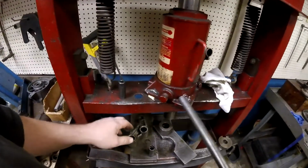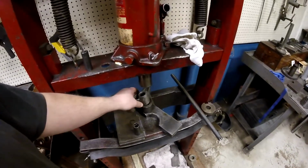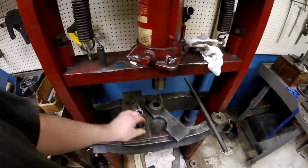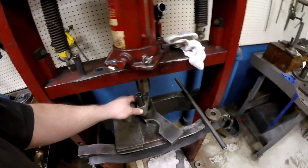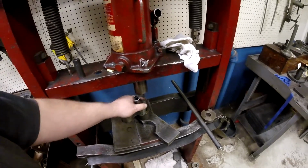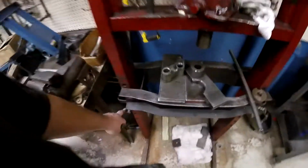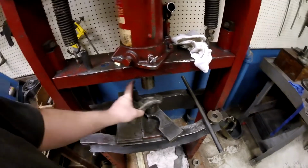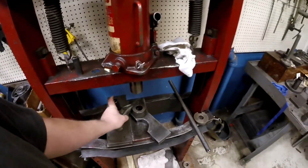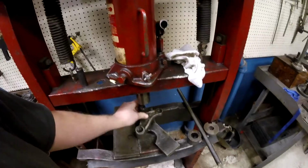Yeah, what we're gonna do is find a nice surface to put that on, just like that. I'm just using this bearing to go in there as a press. You can use wrist pins or whatever other stuff you have laying around. It's no big deal either way. I don't quite have enough height with this adjusted at this setting to put the socket in and press it like that. See, it's not quite tall enough. So I'm going to move this out of the way and I'm just going to press it to the edge, and that'll buy me a few more millimeters.